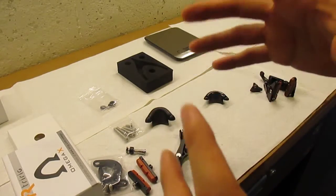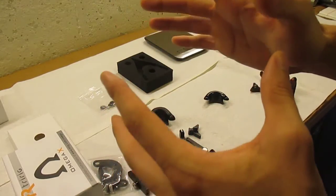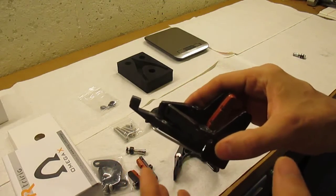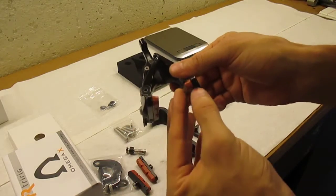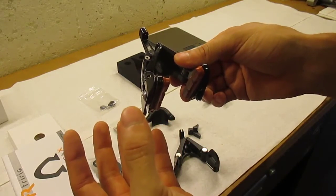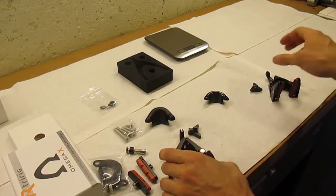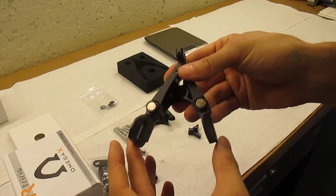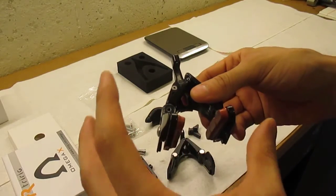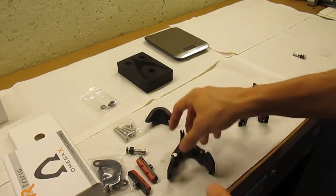Some wheels, as you know, do not sit perfectly symmetrical inside of your fork. So if it was leaning 1 millimeter one way or the other, the adjustment provided in this brake just wouldn't cut it. Particularly if you have carbon wheels and you needed to get that brake pad down far enough so that you're engaging the carbon rim at the right spot so you're not overheating the carbon rim. I had no difficulties adjusting this brake for my carbon wheels, whereas the older brake, I could not get the pads adjusted so that it engaged the carbon wheels safely. That was one of my main motivators for getting the new Omega brake.